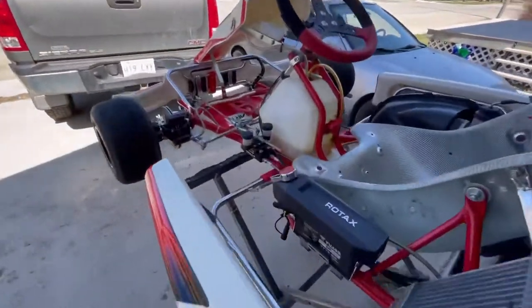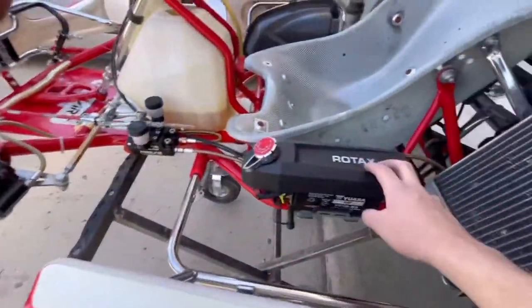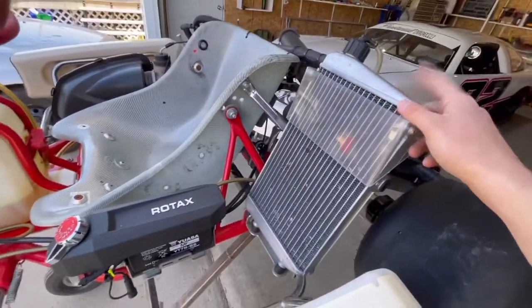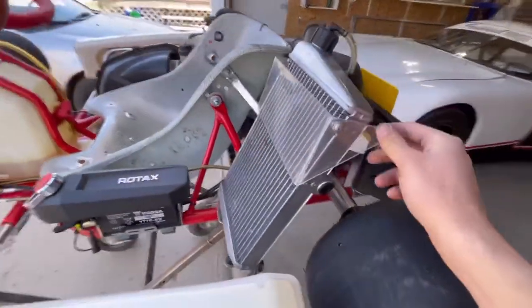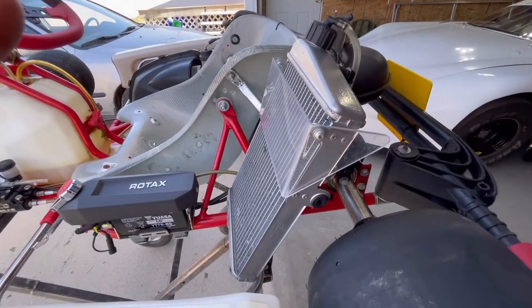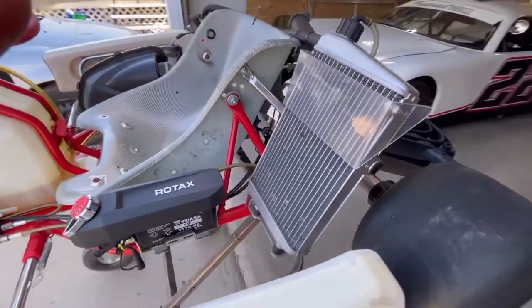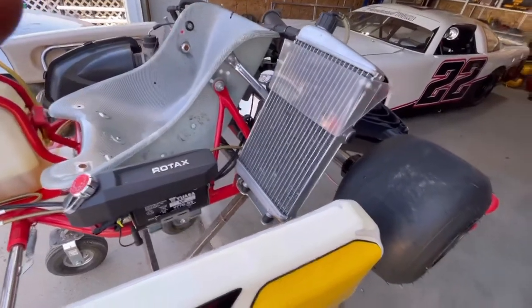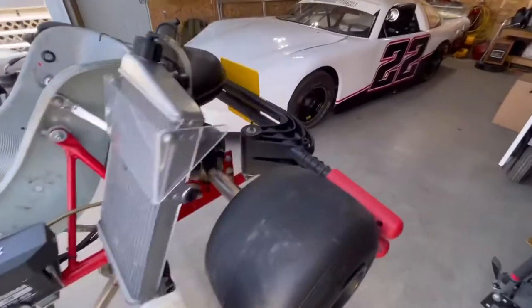As well, we're going to bleed the brakes. Check this battery, make sure it's good. It's going to hold a charge for us. We've got to add coolant to it. It's supposed to run straight water, but up here, it's still freezing at night, so we're allowed to run coolant here for a bit longer. Cylinders are prone to cracking with any kind of cold, so we don't take a chance on a $900 cylinder.